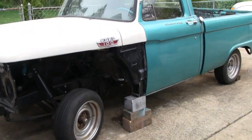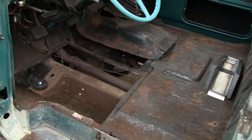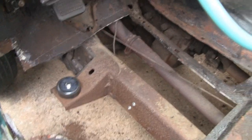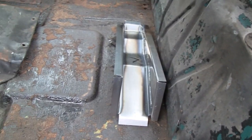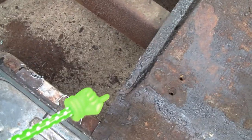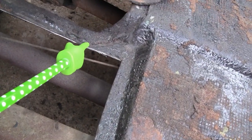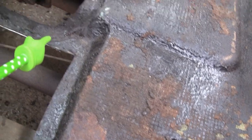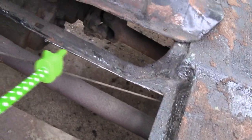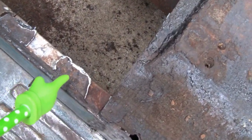I'm gonna work on the old Ford again today. You would think the first step would be to put that crossmember in, but what I'm gonna do is clean up the floor pan right here, get up all this tar and stuff. They've got like a bear bond or some kind of sealant, so right here is gonna be cleaned up. I'm gonna clean all the tar and grind out the sharp edges so we don't get tore up too bad.